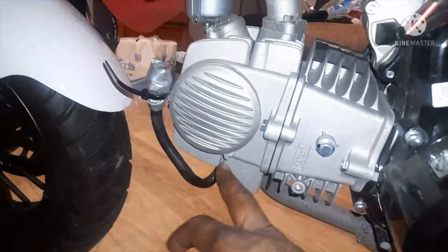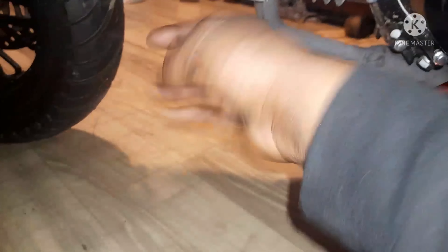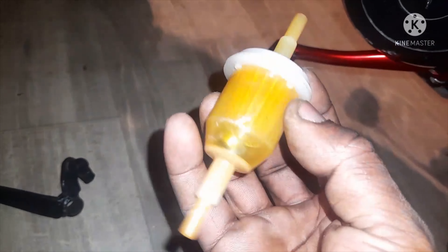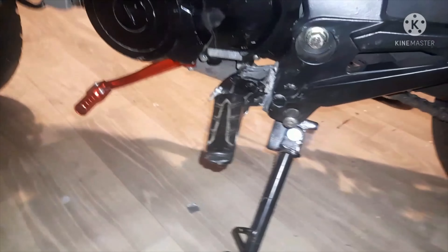Back on the shifting side — I got to get a block-off plate for the EVAP. The rest of the EVAP is already out. Look at the fuel filter that came in this thing — so much trash and dirt was in it, it ain't make sense. Bike ain't even want to run. I done swapped that out though.